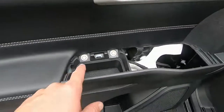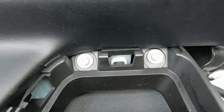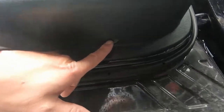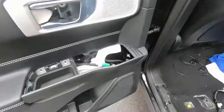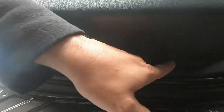Now that we've got that off and the cup holder off, we need to get these two 10mm bolts. This one up here is a 7mm, and there are two on the bottom. Kind of hard to see, but right up in there is another 7mm, and right over here another 7mm. Pull those off and then it's just popping the bottom out of the panel, and it should be ready to lift right off. Now we have those two bolts off and the two bolts under here — one there and one right there.